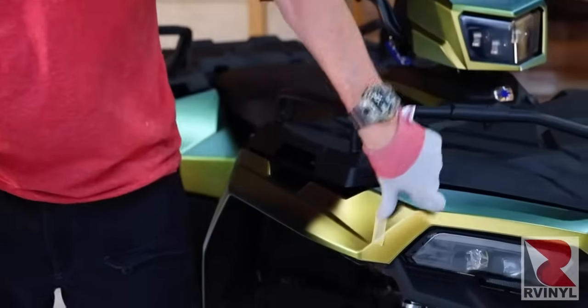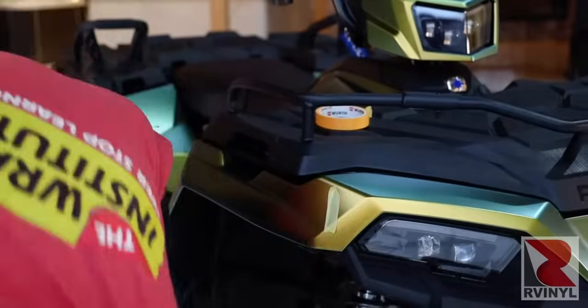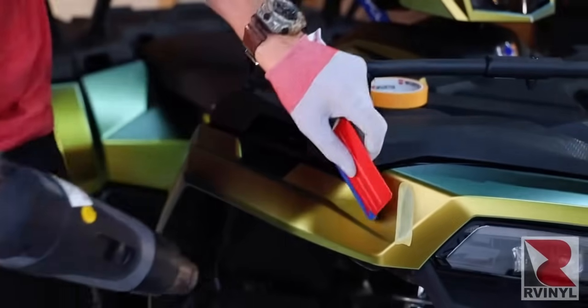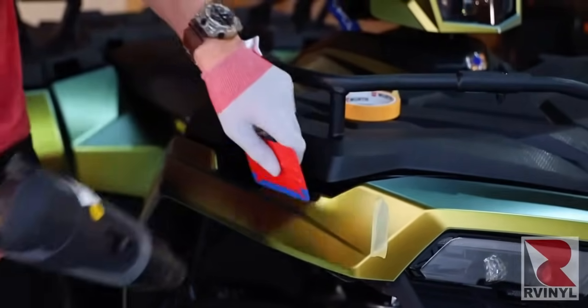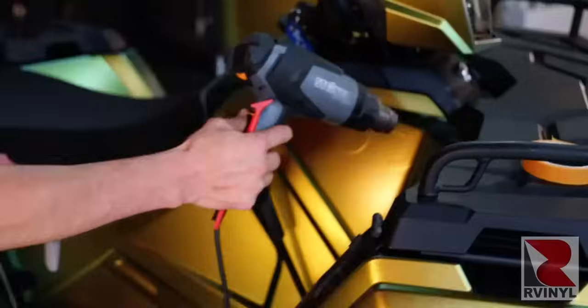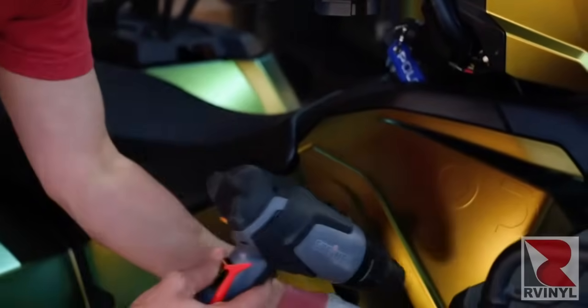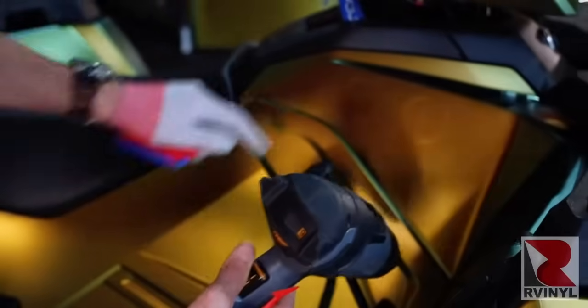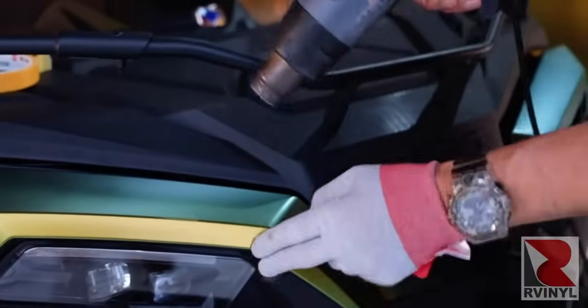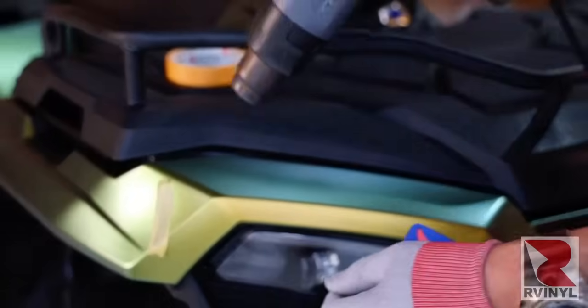And the final step is to place tape on one section of the ATV and then do a 360-degree check over. So you loop around the entire ATV, and with the heat gun, squeegee, application glove, and tucking tool, be extra thorough and double check that all air is out of the recessed areas, all the edges are 100% down, and all the overlaps are 100% tight. This will ensure long-term hold and a quality, durable ATV wrap that will last for years and years.